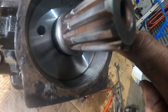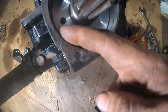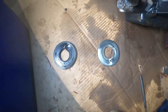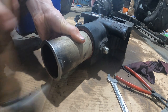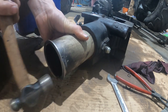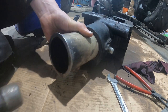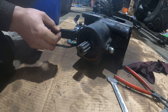Someone's definitely been in here before — when they flicked the old seal out they really battered the side of the housing, digging in there with a chisel or something, and there was no need for that. I just used my seal pick, knocked it in the middle, and flicked both seals out cleanly. I've put some gasket goo on the outside of the new seal to smooth out any imperfections in the casting, and wet-and-dried it smooth so it won't rip the seal. Got a dolly the right size, knocked the new seal in nice and tight, and put the tin shield on.